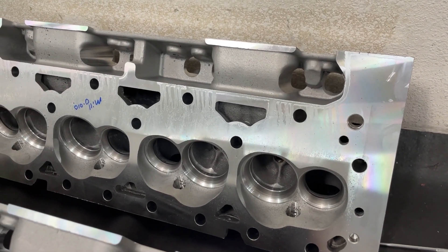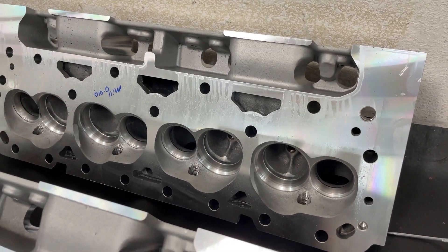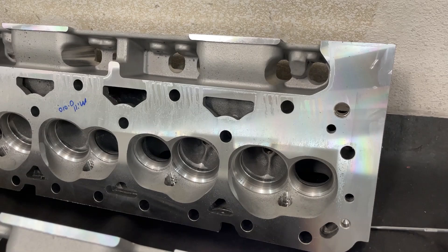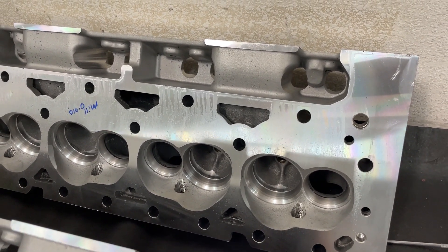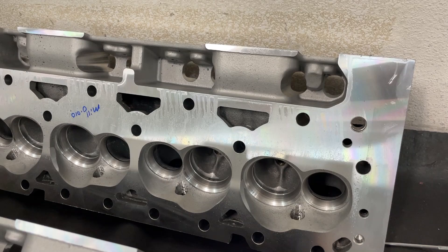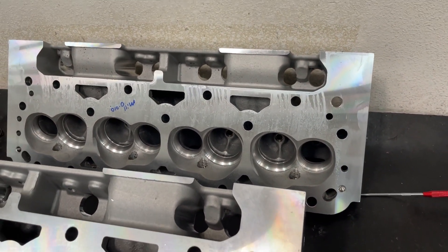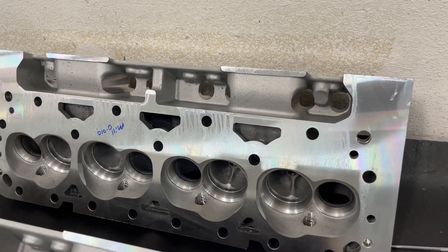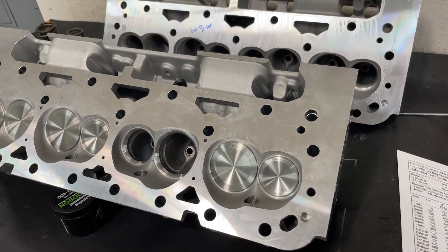I've got one head done, I've got to finish this one. You'll see a really heavily modified version of it — these are with 11/32" stems. Right now this one is cut out to 2.08" intake valves, still a 45-degree seat. This thing will probably move quite a bit of air when it's done. The one I used for my sister's moved 315 cfm — I think this one will probably match it and have better low-lift numbers. Anyway, thanks for watching — you guys take care.